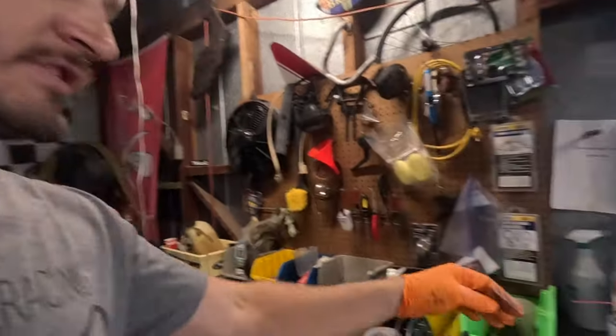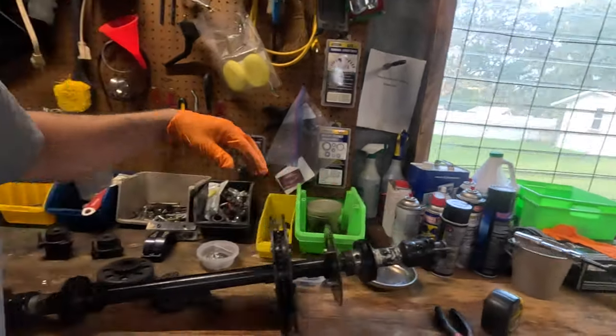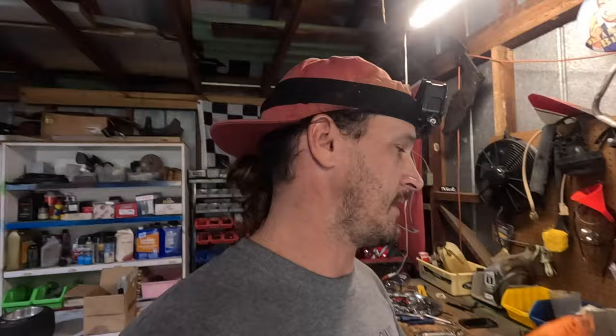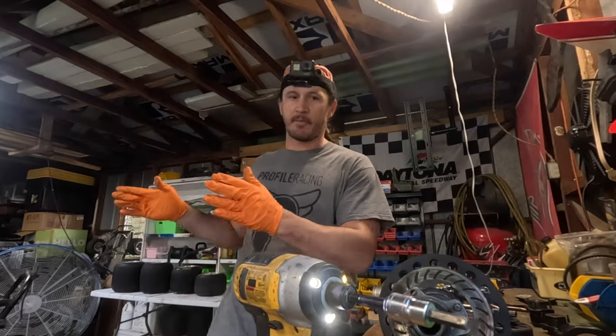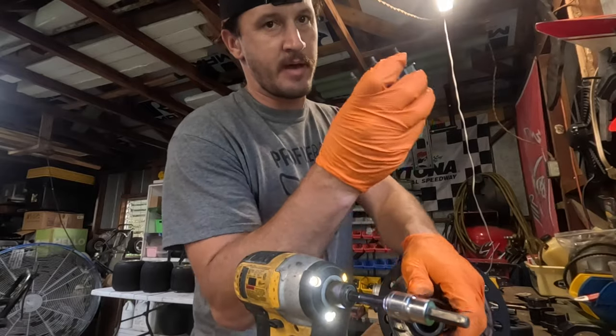On my cart I run these spacers — it was on the first cart I ever bought and I really like the concept. I have a bunch of individual spacers and I use them as a spacer to the outside hub — that's my neutral set. I do some adjustment to get out of the corners a little better on exit. I have a general reset, and that's where it's at, so I know I'm at four and a quarter / four and a half at all times. Everything on my bench is set up the same way it was on the cart, so this is my right side hub — keep it on the right side.